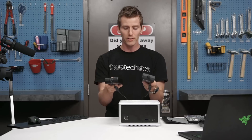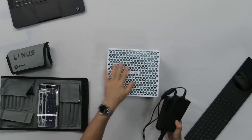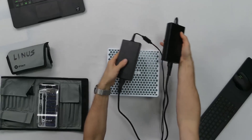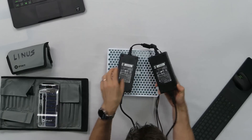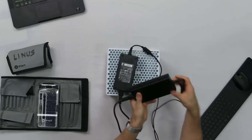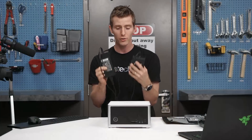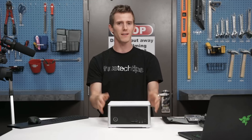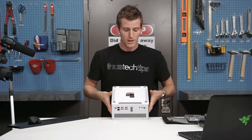One of the unique things about this system is that while they managed to pull off an impressively tiny form factor, they took the power external — something I've been saying more manufacturers should do. I've talked to Cooler Master and Silverstone about this. So this is two power bricks, about 180 watts each, giving a total of about 360 watts of power delivery. That might explain why the CPU is a Core i5 rather than a Core i7 or 6700K, because that 980 graphics card is going to really suck up some juice.